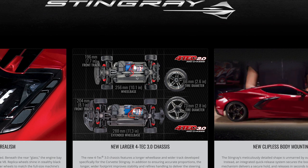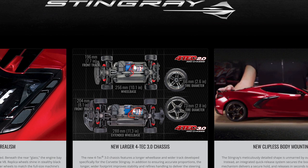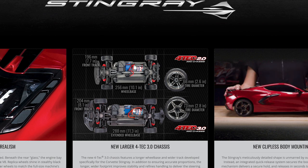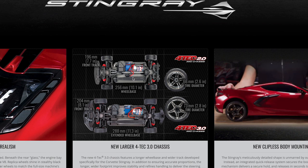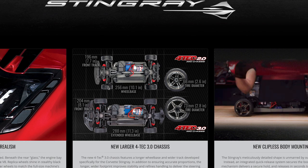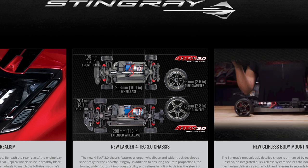The car does hit 70 miles per hour. I used a different body — in stock form with a Mustang GT body, because you don't have a wing and the aerodynamics aren't that great. You're never going to hit 70 miles per hour under normal conditions because the car is just going to lift and grow imaginary wings and try to fly like a chicken. Aerodynamics plays a key factor here — there will not be enough downforce, so your tires are spinning and not getting enough traction at that speed. Hopefully with this front diffuser, that will help out a lot.